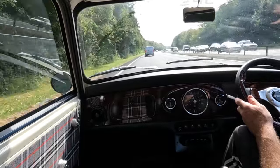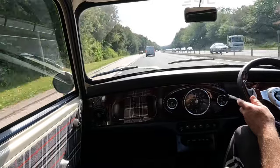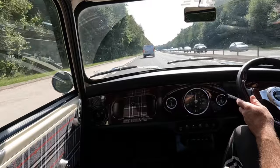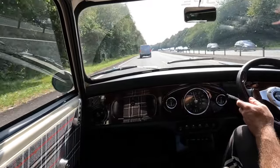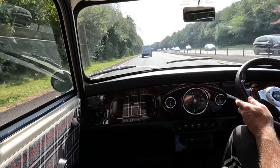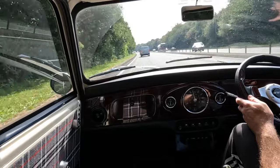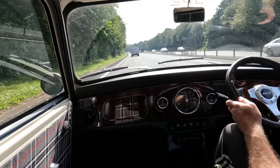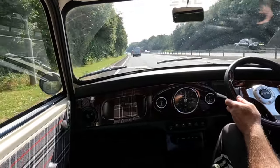I didn't realise this and I think I've placed mine with the not-so-good side facing the engine bay, but you can hardly tell if I'm honest. Regarding gaskets: I didn't need one on this setup, but apparently on some carbs the lower edge of the float bowl can sit closer to the base plate than others. If it's tight they install a couple of gaskets between the carb and the base plate. They're also working on a spacer plate as brand new carbs can be particularly tight, now coming with a CNC machined float bowl which can be chunky. If there's no fitment issue, a gasket isn't required.